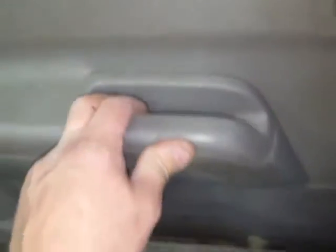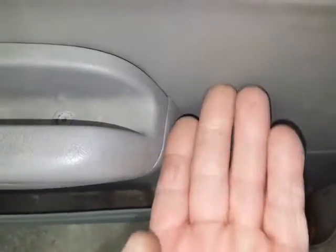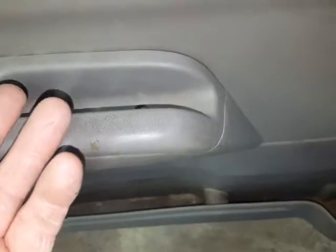I just had this door panel off. It was wiggling all over the place before. There are two little spot welds and a little piece of flat angle iron that comes out, and screws go into it — two little dirty screws down there. The spot weld was broke. I took the door panel off and heard some metal falling in the bottom, so I used some self-tappers — put three in — and now it's solid again.